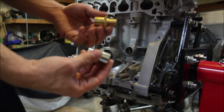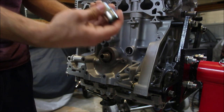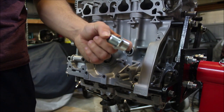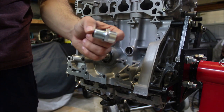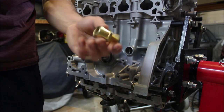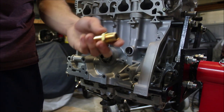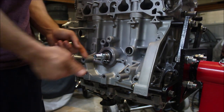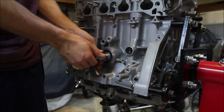Something I found out: you won't actually use both adapters — you'll use one or the other. In my case I just have to use the silver one. If you're working on a Honda D16, you'll most likely be using the silver one. The brass one — I'm not sure what else it applies to, but the thread pitch is wrong for this motor. The silver one does fortunately screw on.